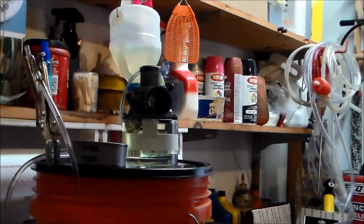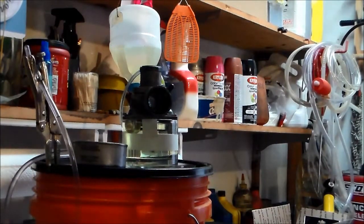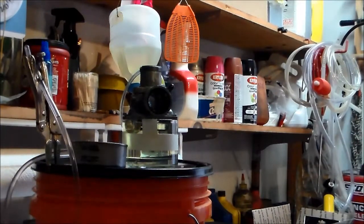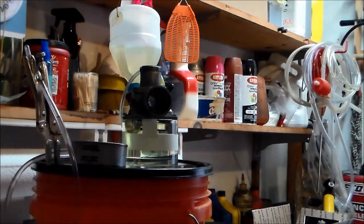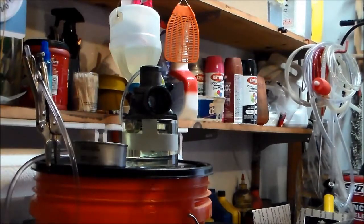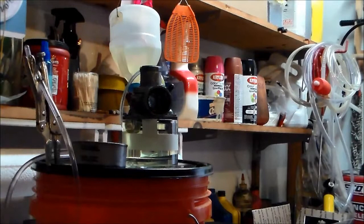As far as the leakage goes, I usually let them set for like 5 or 10 minutes. With the steel needles seating against a steel seat, instead of the Viton needles, my feeling is they're going to leak. Okay, steel to steel really doesn't make a good seal of any kind. Much like our check balls in the oil lines. So if you let this sit for 5 minutes or so and you don't see a rise, but you did in an hour, I wouldn't worry about it, because when the bike is running, we are burning fuel. For as long as we're burning it faster than we're leaking it in, it should be good. If you got the Viton needles, then you should be good.